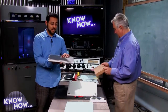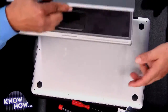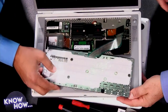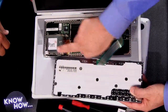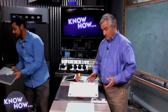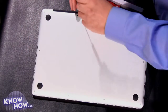I think Apple also does it because it's less likely you'll do it yourself. Here's an old 2001 PowerBook — it has actual old screws you can use a regular screwdriver on. If you wanted to upgrade the RAM, you'd just pop off the keyboard. We're going to look at the same kind of thing in the new MacBook with Retina. First, let's remove the screws using the pentalobe screwdriver. There are ten screws total to remove.